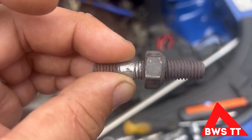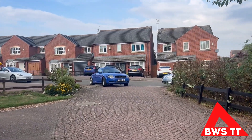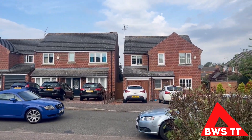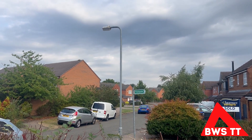The previous studs obviously weren't reusable, so fresh studs on there, ready to go in. I've been digging through for hours trying to put this video together and I realised I haven't got the clip where I discuss everything that happened with the Noggy. But basically, as soon as I bought it and posted a couple of pictures saying this was the next one I was working on, a mate got in touch — 'Brin, I want to buy it.' I explained the issues: the turbo wasn't boosting properly — I needed to investigate — and he was happy to wait. Found out the wastegate was the issue.